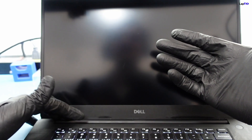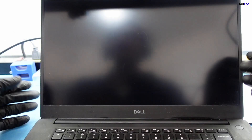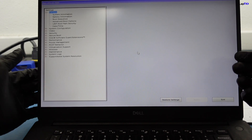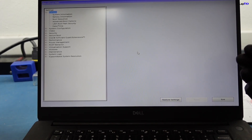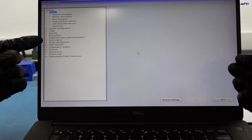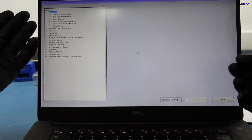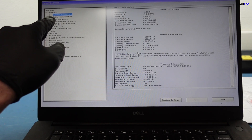If we turn it on, we can actually hit F2 — that's what you want to do first. You'll see the backlight keyboard lit up, and what you're going to do is go into the BIOS. We're not recommending changing any of these settings in the BIOS — that's a little bit dangerous because you can make it not boot, you can erase things. Especially in the Dell UEFI, there are lots of different settings; you can wipe the drive, disable features. We're not touching anything; we're just going to look at battery information.